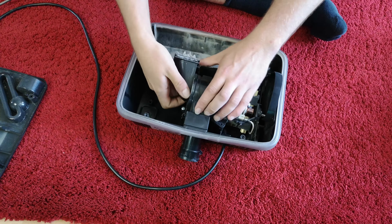We need that part there. To get to that part we have to take a few things apart. So we'll remove the brush roll, take the belt out in a bit. Then we have two more screws in order to remove the motor housing.